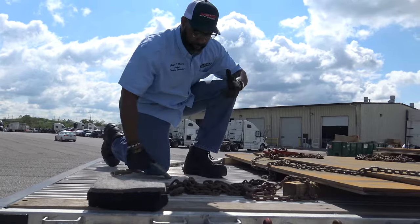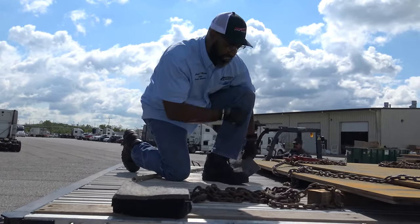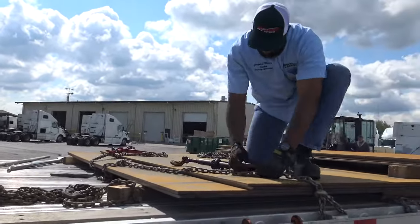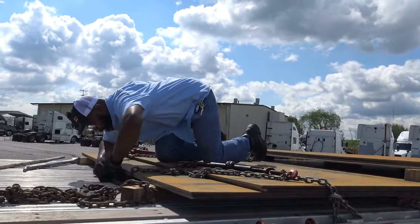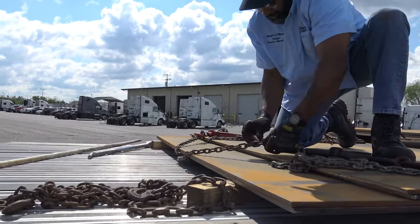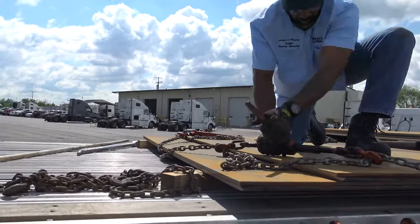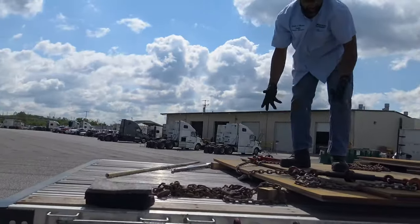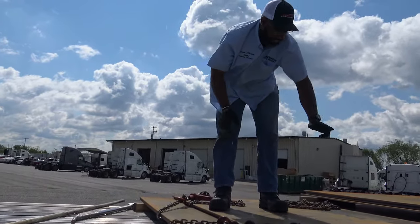Keep that lid up here so when you pull it, it'll stay. Wherever the chains meet, you're going to have to put a friction pad so you don't wear your links. Because if DOT inspects one of your chains and your chain is worn, then you can get an unsecured load ticket. I'm going to keep it snug and then put it where the chain links meet. I made sure my felt pad was in place so I can go ahead and bind my chain. Now I got my first X-chain on with my felt pad where the links meet right in the middle.